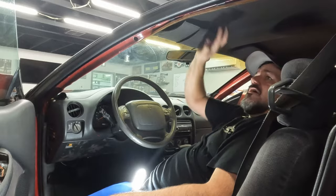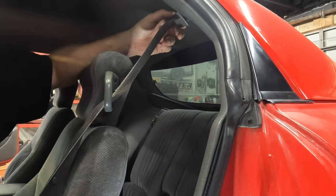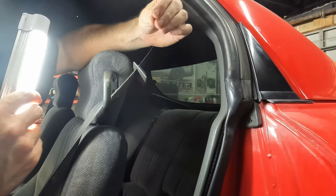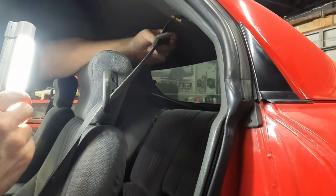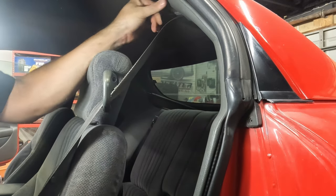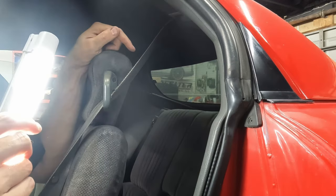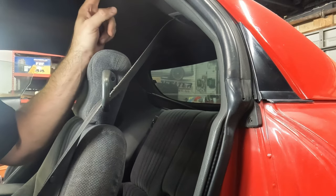Visors are in. Headliner's in. So then we just put our trim back. This trim piece here has to go back around the body frame pinch weld inside the weather stripping, and then this clips back up there. And then we'll put our A-pillar door frame trim back up. That was harder than I thought it was going to be — I'll admit that.